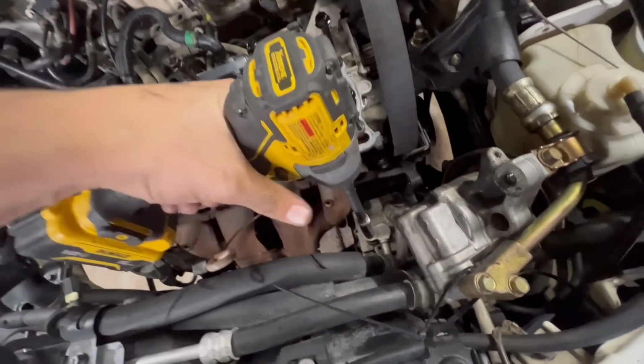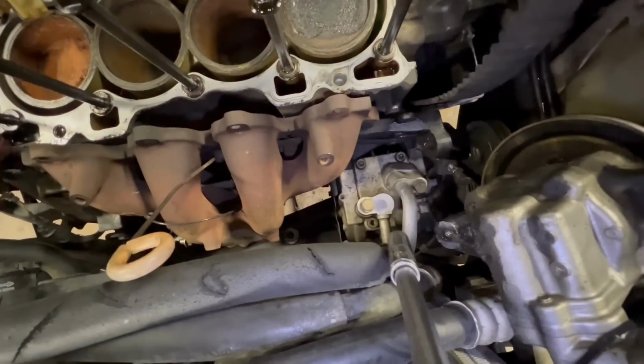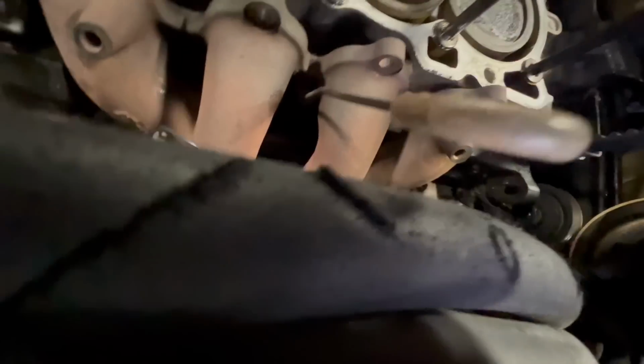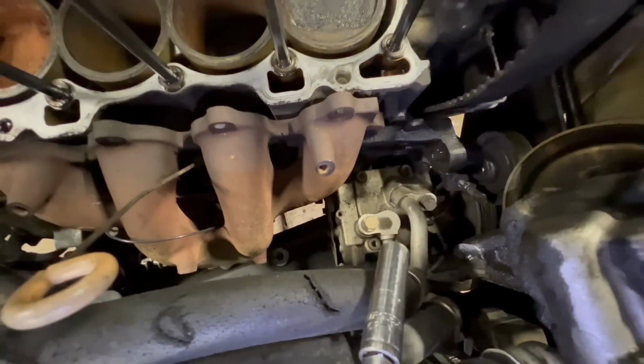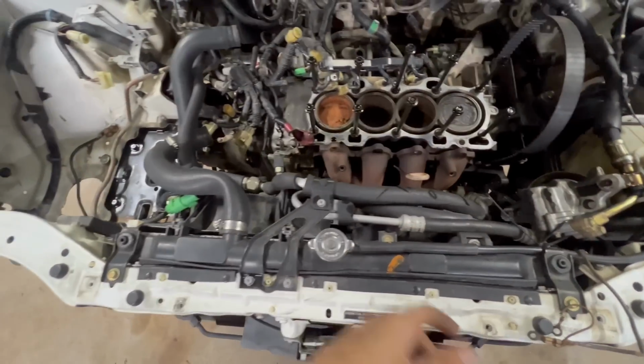Alrighty, so I relieved the pressure from that valve there and also the hot side valve. So all I need to do is just unbolt it here on both sides, so that we could just drop it all as one. Honestly, it's too tight of an area to try to figure out the bolting situation of it all. So I just decided to drop it all at once. I'll redo the seals and then just get it recharged and everything like that, which will be better because then it'll be ice cold.